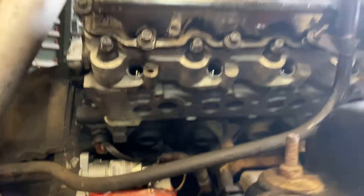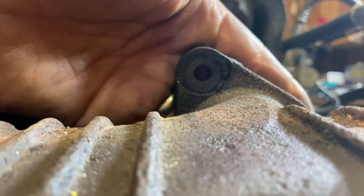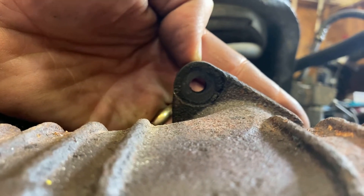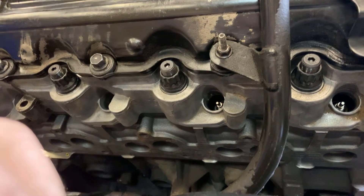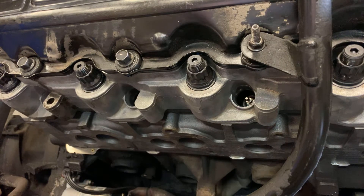On the exhaust manifolds there is one hole that is smaller than the others. According to the manual, you start with that smaller hole to get it hung on the cylinder head because it is more precise and helps with alignment. I set the phone down and demonstrate getting it positioned — and yeah, that doesn't look terrible, I think that'll do good.